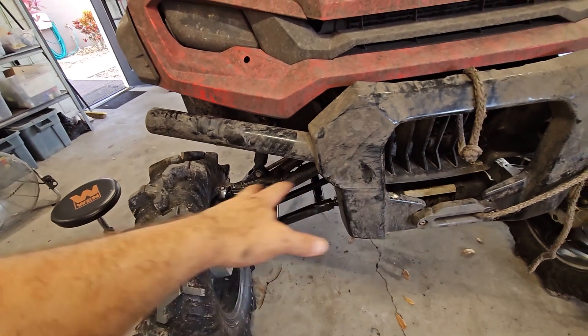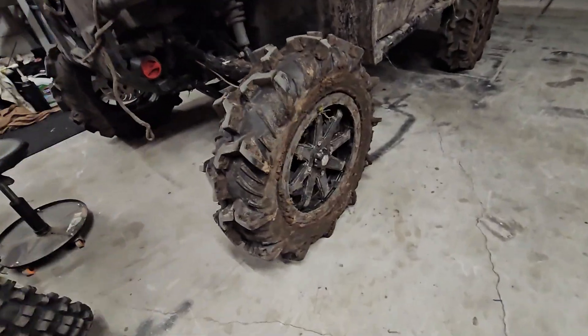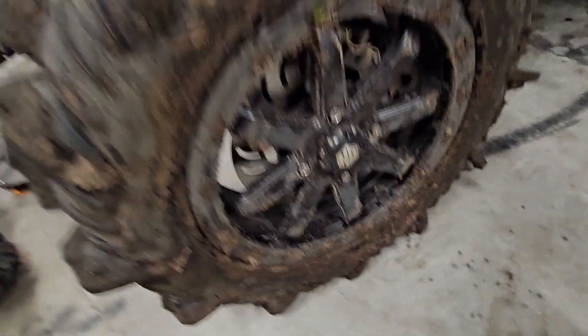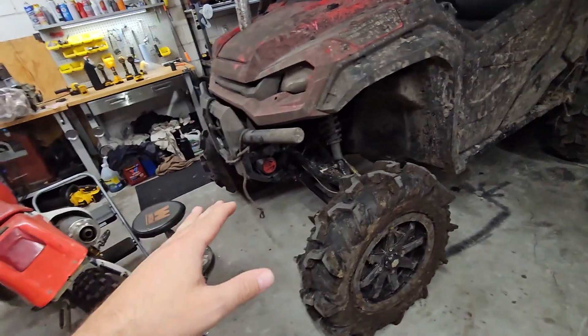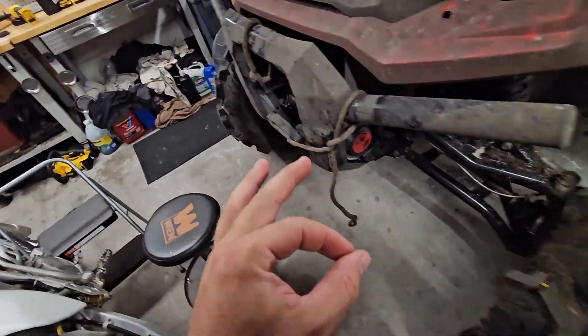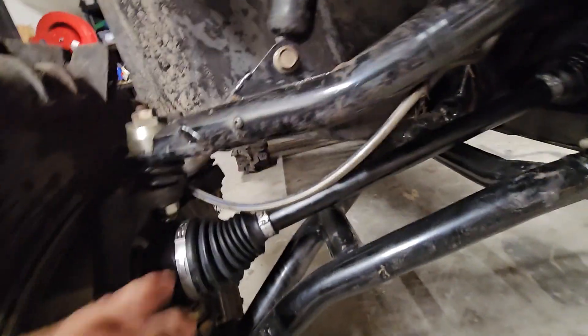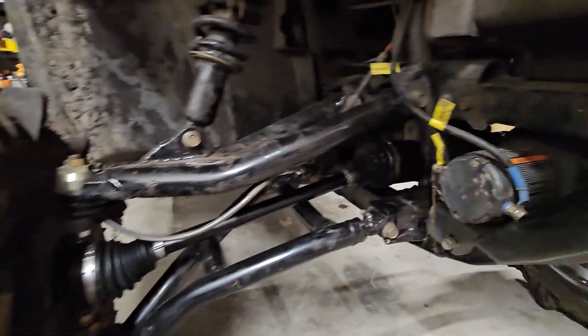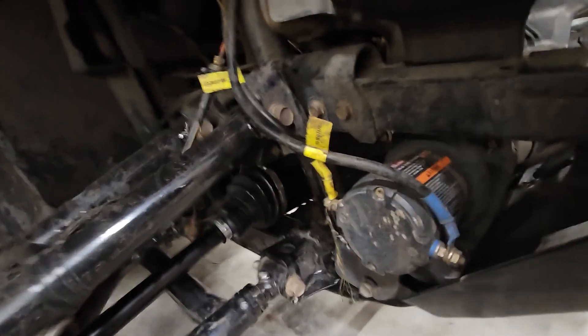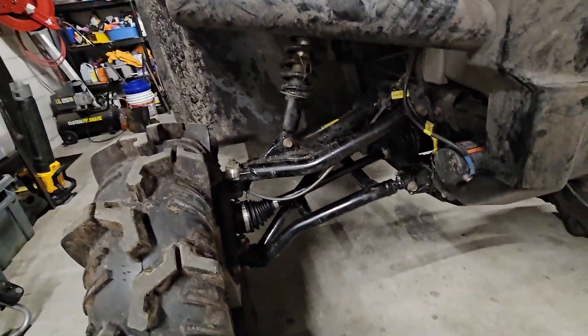I just gave her a little test run in the pond. Got it totally buried with the back end, locked it in four-wheel drive, diff lock low, and let the front bounce and eat. Everything feels very solid, so I think the install is pretty good. I'm going to check the torque on the upper ball joint I had to remove, but everything looks really solid. Always check that your axle is fully seated into the diff — which it is. Boots look good, there's no grease coming out anywhere. Ready for Holopaw tomorrow.